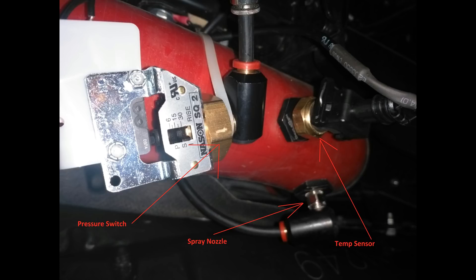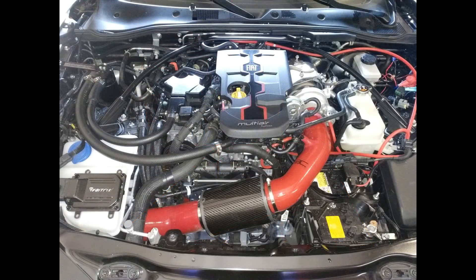So that's the whole system except for the controller. In the past on these cars, I had the water injection configured to either be off or, above a certain level of boost, it would switch on. I was controlling the quantity of spray via nozzle sizing. An on-off system, although very common, is far from ideal because the engine's water needs vary with both boost and RPM. If it's simply on or off, then when the system is on, it's spraying too much at low RPM and not enough at higher RPM. This not only sacrifices performance, it causes you to go through the fluid at a relatively high rate, since every time you want to pass on the highway, the system goes right into full spray.